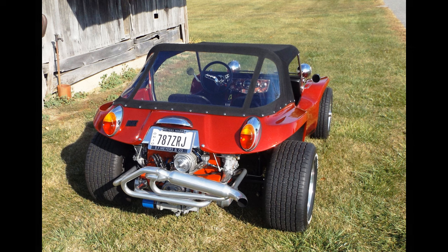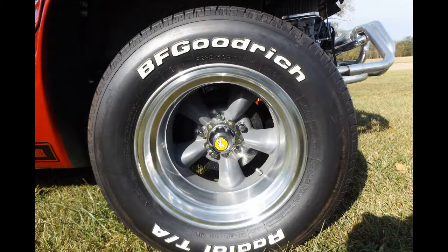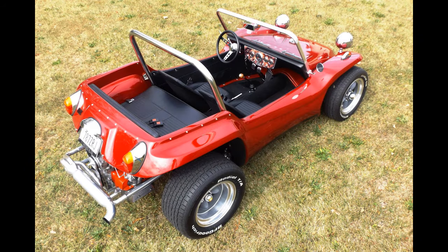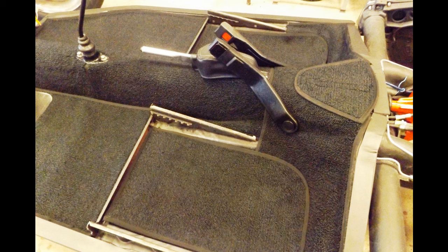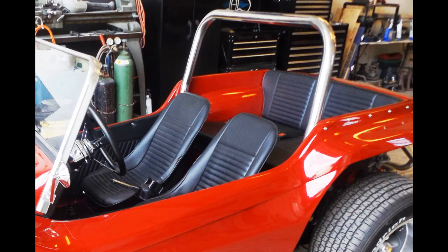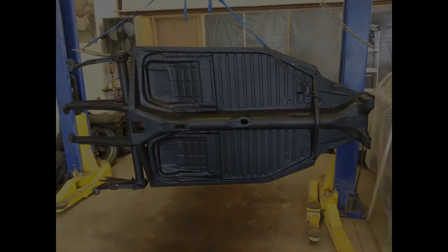Custom front disc and rear brakes eliminate the need for weak wheel adapters and also tuck the tires into the body for a more original look. Seat platforms were custom water jet cut. They are lowered 2 inches to utilize the original seat slides, locks and floor rails. This adds to the car's sleek appearance. Finally, the pan was put on a frame machine to assure accuracy, then sandblasted, primed and completely coated with bed liner.